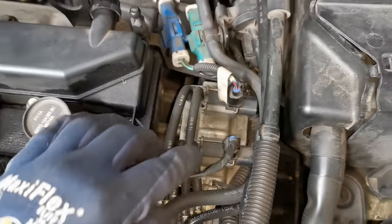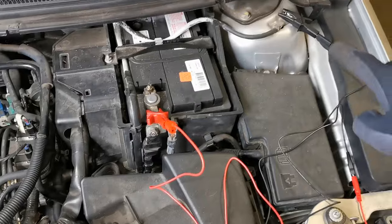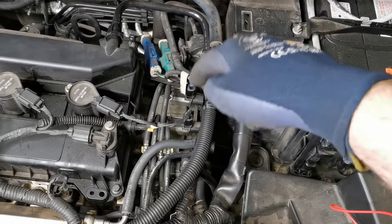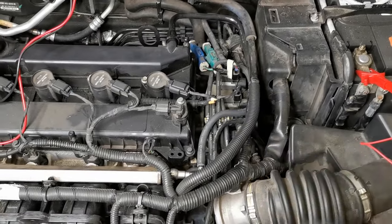In this one I'm going to be removing this connector, checking the resistance across both of these, and also doing that power test on it. I have my multimeter over here and I have my cable for the battery where I'm going to be sending voltage directly into it. Very straightforward, very simple checks — I'm going to set the camera up so you can see it.